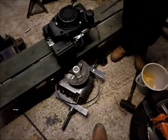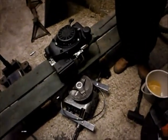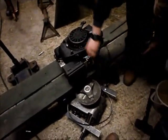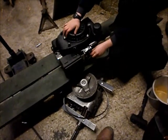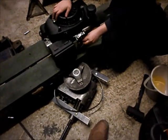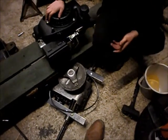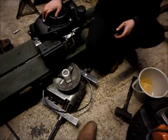You're probably wondering why the engine was revving and not revving. Basically what it is is the governor. When you're mowing the grass and you hit a dense part, the governor would pull the throttle back and give it more throttle. So that's what it was doing there. But as soon as you get up to the high RPMs, it's fine.